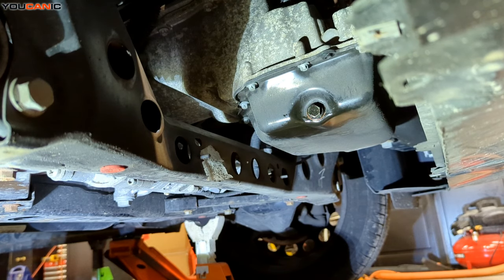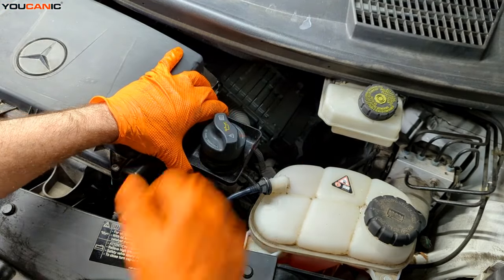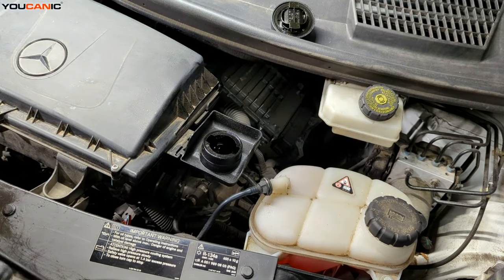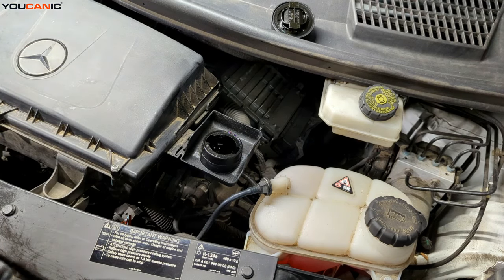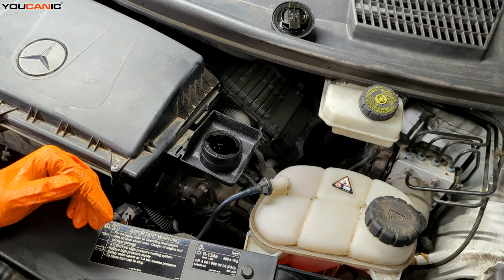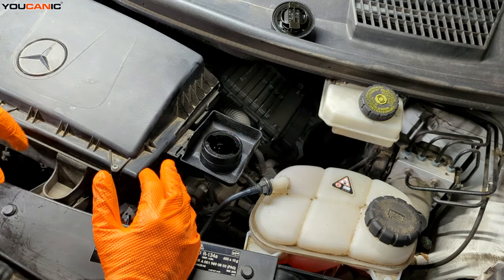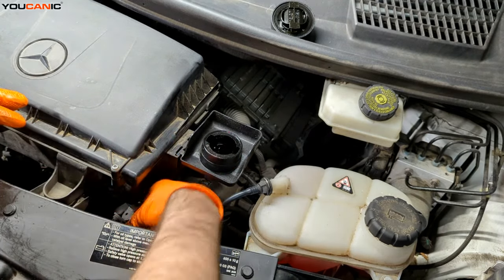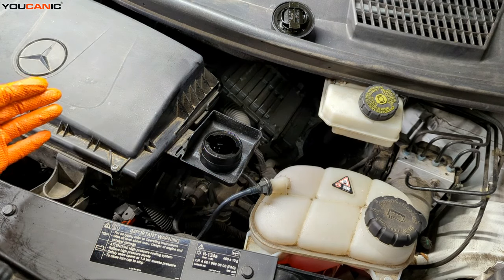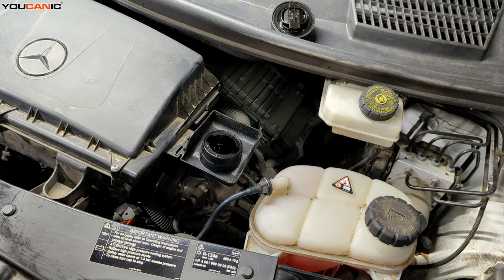Now it's time to add oil to our engine. From up top here, this is where you add your oil. Mercedes recommends Mobil 1 with 0W-40 — put that in, or something that meets the Mercedes spec of your oil choice. We add about 7.4 to 8 quarts. Add around 7 quarts first, then start the car to fill up the oil filter, and then check your dipstick — remove it, wipe it clean, and check the level. And so that's how you change the engine oil on your Mercedes Metris with the 2.0 liter motor. Thanks for watching.